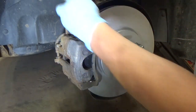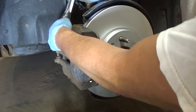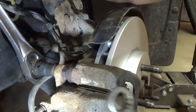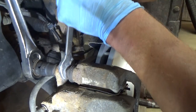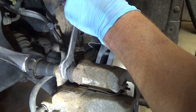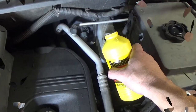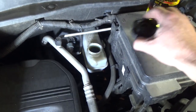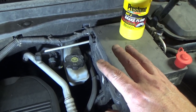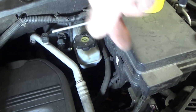If you liked this video, give me that thumbs up and if you're not a subscriber, hit that subscribe button — I have a lot of different kinds of videos: ATV repair, auto repair, cleaning my own boiler. See, now this pin is spinning — it's going to take an 18mm wrench to tighten that down. These caliper bolts are 18 foot pounds. For these ones I'm going to use my highly calibrated elbow to torque them down. Don't forget — you're going to top off the brake fluid, replace the master cylinder cap, and then pump the brake several times so that you have a stiff pedal before you begin to move the vehicle. Then move the vehicle slightly to make sure it stops before you head down the road. Have fun, be safe, and hit subscribe — thanks for watching.